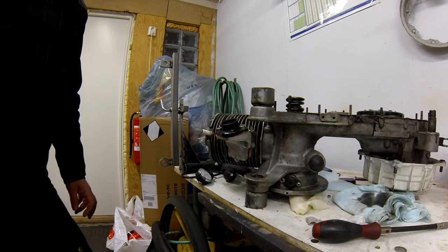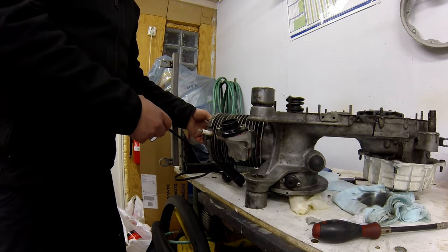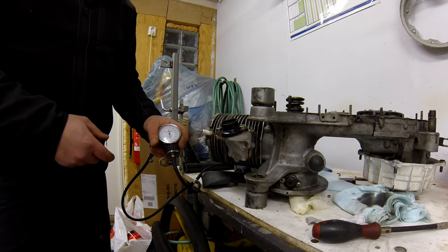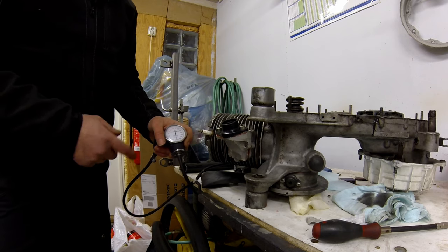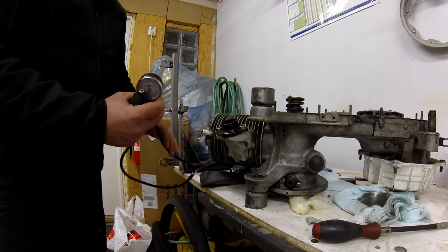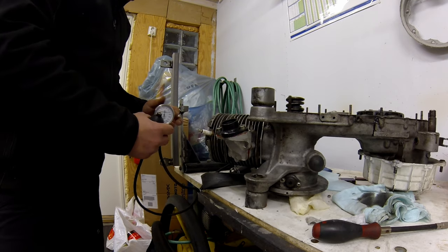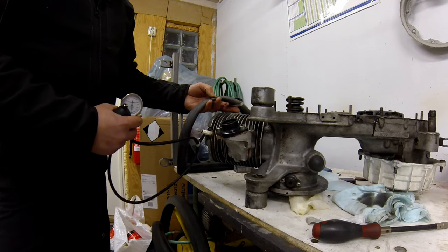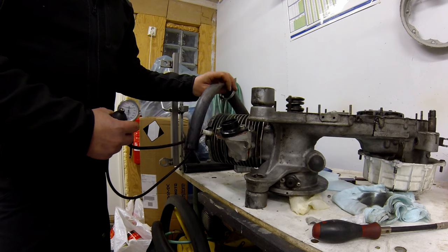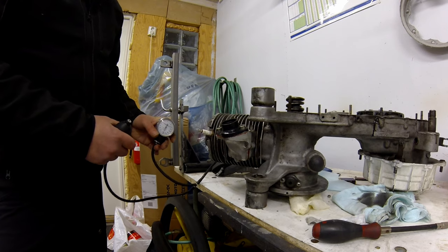So I told him to bring up the engine and we decided I'll do a leak down test. What I'm using is basically one of these sphygmomanometers - we'll call it that - which is essentially a blood pressure tester with a little pumpy thing. These are really cheap on eBay, around 20 pounds or less. The other things you need are a bicycle inner tube - use a mountain bike inner tube so it's easy to get over the manifolds - a bit of gaffer tape, and some clips.